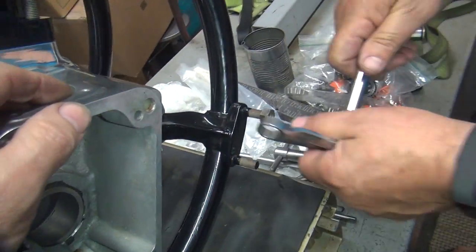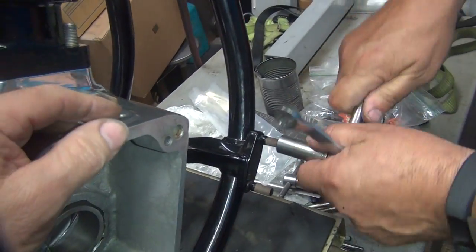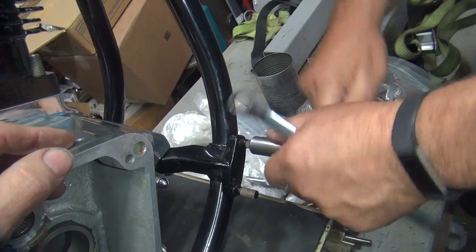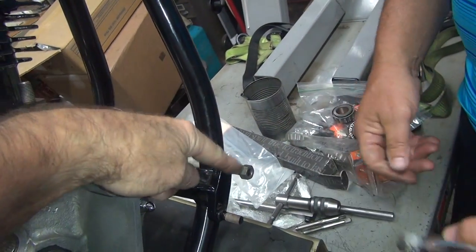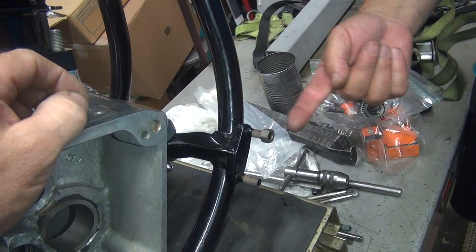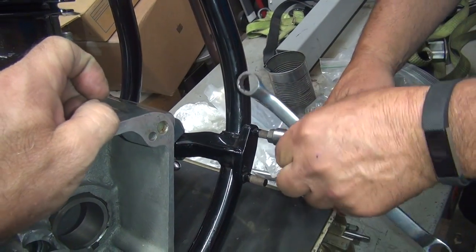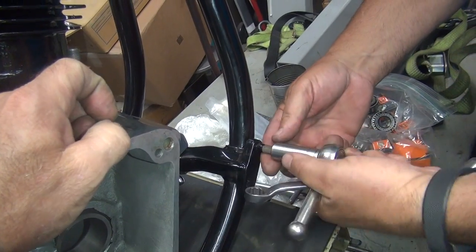So, what are you doing there? I'm going to run this thing in here. Why are you tearing up the thread? There's no point. We're taking it out. Yeah, but you're screwing up the nut. So take a little bit of oil, put oil on it so it doesn't gall up on the way in. What, that nut? You're worried about saving that nut? We got to get the nut all the way on there before it screws up the threads, and you might not ever get that thing out.